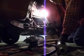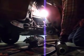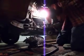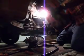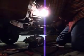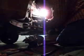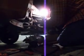Installation is same as removal. No tricks or gimmicks there. Just do it the same way you undid it. Just make sure you line the axle up on the spline on the transmission. You definitely don't want to ruin the teeth on that. You'll be getting yourself a new transmission real quick.